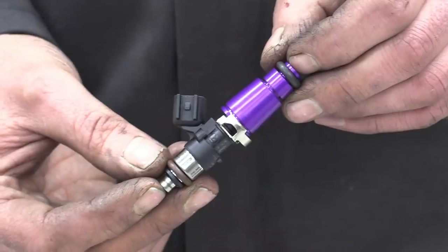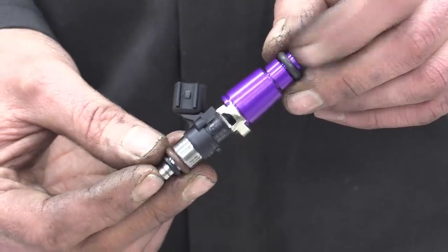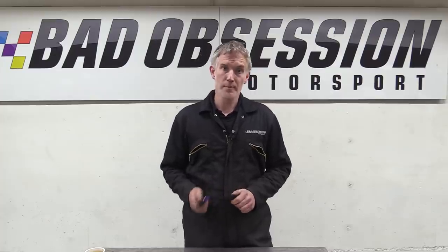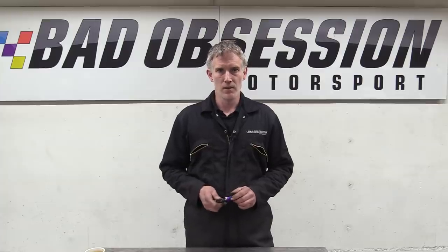It's just they're attached to a set of ID1050Xs. Other than the sharp pain to my wallet, this is good news. These are the latest injector tech and a direct catalogue replacement for our old 1000s, so they should be perfect. Only they're not.